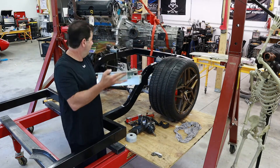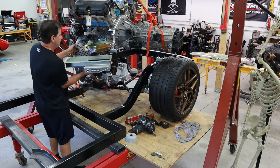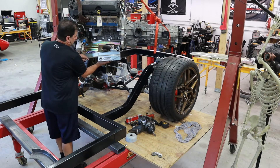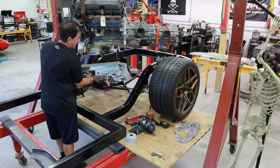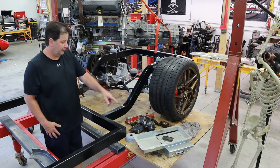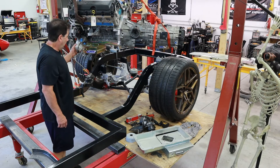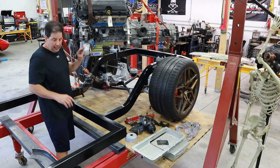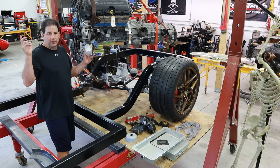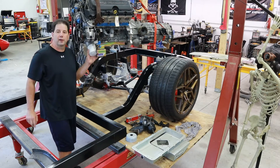This is a low-profile job — obviously it's the rear sump versus the front sump I've got on right now. It's going to allow me to run an inch-and-a-half pipe across there and tie those two motor mounts together. The problem is I don't actually have a pickup for it, so I've got to order that today. We're going to put this motor aside for right now and go ahead and start focusing on the front. I've got a plan there — I'm getting rid of all the old C6 frame and building my own frame, so let's go ahead and get started on that.